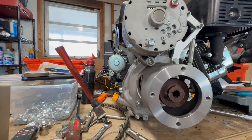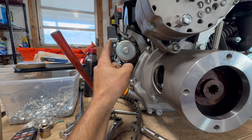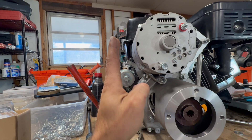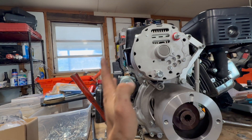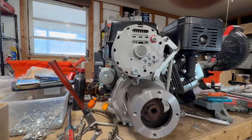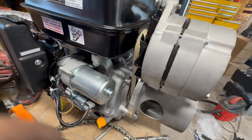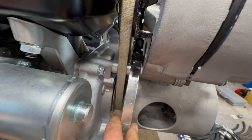The key is we can't go past the starter. This is the electric start box, but our machines don't have that, so the firewall of the machines runs right here. We have to make sure we keep this alternator on this side of its halfway point. This is the best I could come up with without cutting the pump adapter or messing too much stuff up.